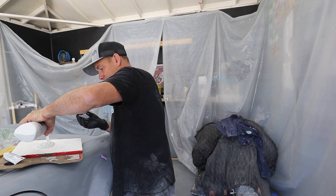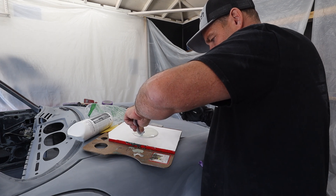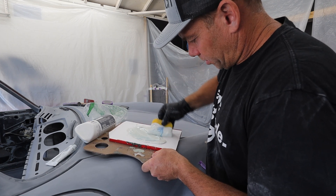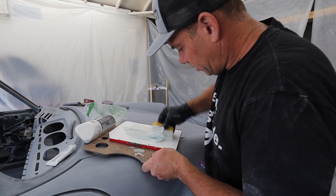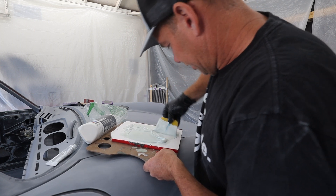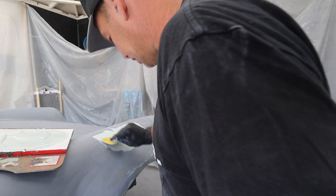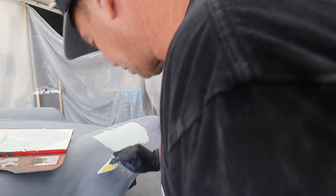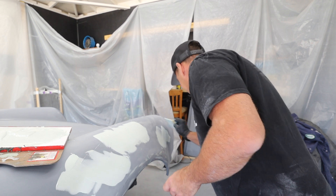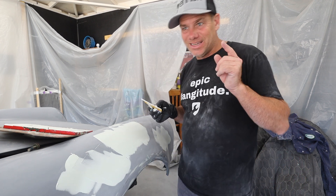This stuff is like creamy — it's pouring out. I've got a four-inch little pad and I'm making a pancake — one little stripe. It goes off after about three minutes, which is why you've got to mark it with tape and get to work. I can already tell it flows really well — it's meant to have no pinholes and the nicest sanding surface possible. It feels lovely and smooth. Put it as thin as possible, and it's setting up buttery smooth. I've got the first pass done on the car. I'm going to let it dry and go play some pickleball, and revisit this tomorrow when it's fully set up.